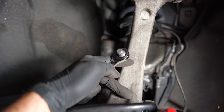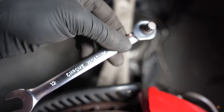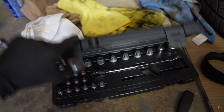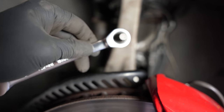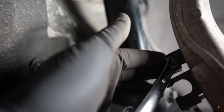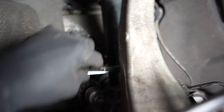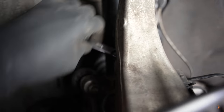For the next step, there are two M10 triple square bolts that go here and here. It's a little tough reaching them and you need a stubby tool just like this. Luckily ECS sent me this because I had a longer one that didn't work. It's on their website — I'll link it in the description below. This tool is honestly a massive lifesaver, so go ahead and order it if you're doing this install. I have the ratchet on right now — you can see the bracket here that holds the brake lines and the sensor. This tool makes it so much easier; you will not be able to reach with something else. Just get it.